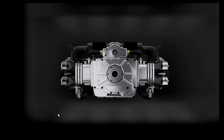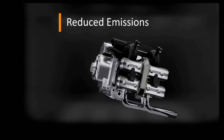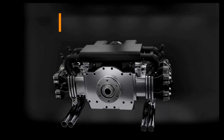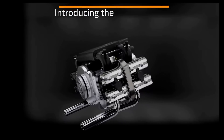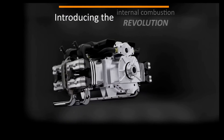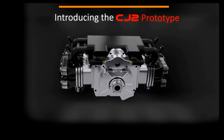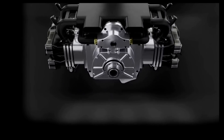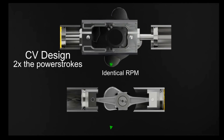Direct injectors, I'm imagining, with extraordinary fuel efficiency, fewer and cleaner emissions, impressive power-to-weight ratios and full-range torque. This — how long have you been doing this? 'Simple engine design will revolutionize energy and transportation' — oh, they always do, right? They always say it's a revolution. But let's compare the CV design to the standard crankshaft one. The advantage is the number of power strokes per shaft rotation. So it's a two-stroke then, basically.